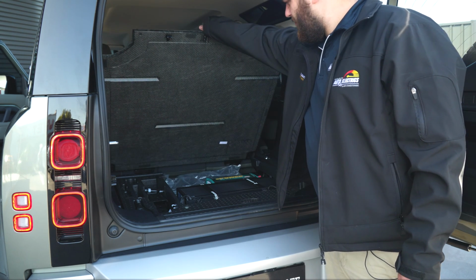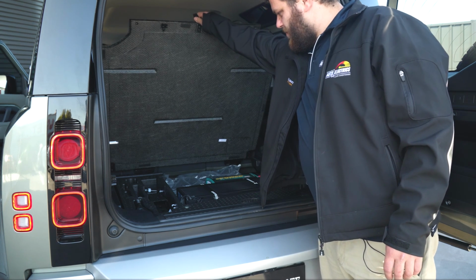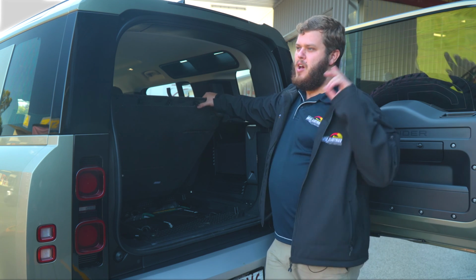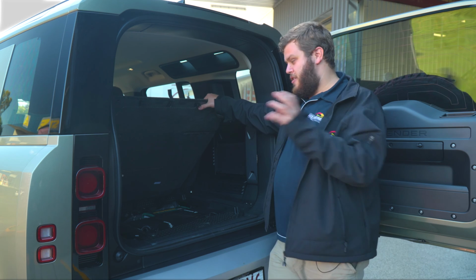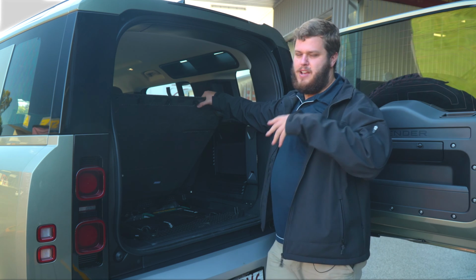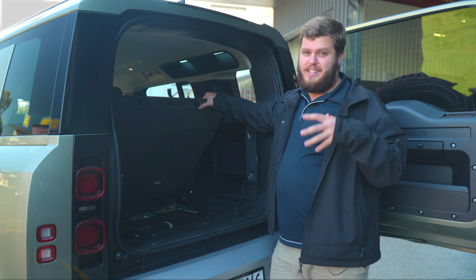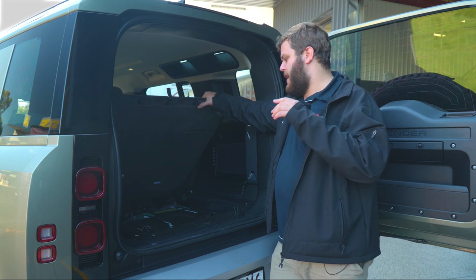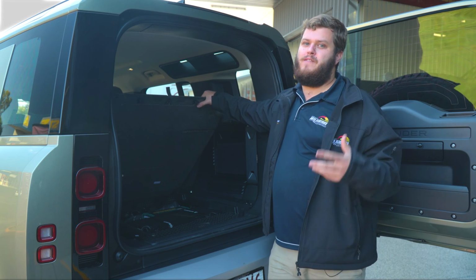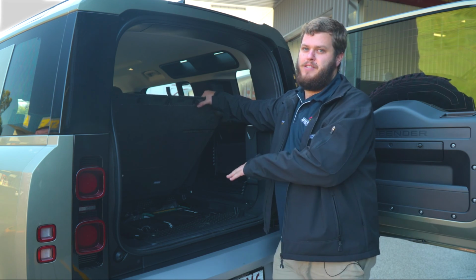Second thing, IEC certification. So INVICTA lithium batteries at the moment are the only lithium battery on the market that has an IEC certification for the whole battery, not just the cells. What that means is, essentially, it's the only battery that's gone through all of the extensive heat testing, fire testing, all the safety things that you'd want in a battery. It's the only one in Australia to actually get that certification. Later in the year, for caravans, they're actually making it mandatory to have this certification. So INVICTA are ahead of the ball game. They always have been. These are the bee's knees when it comes to batteries.